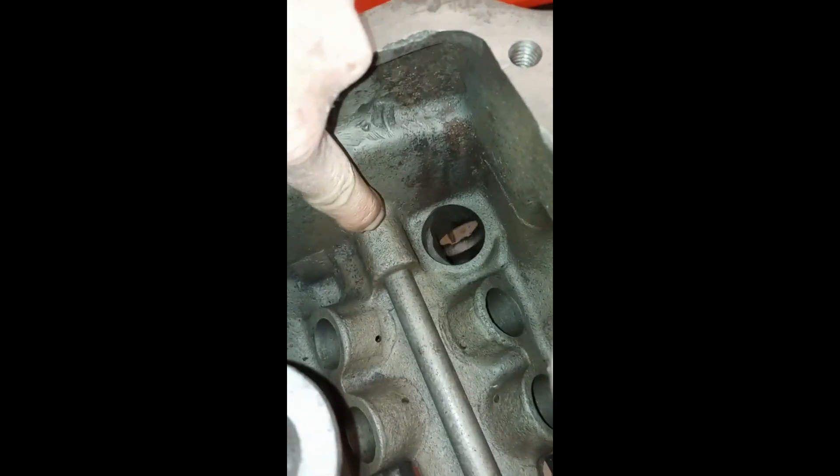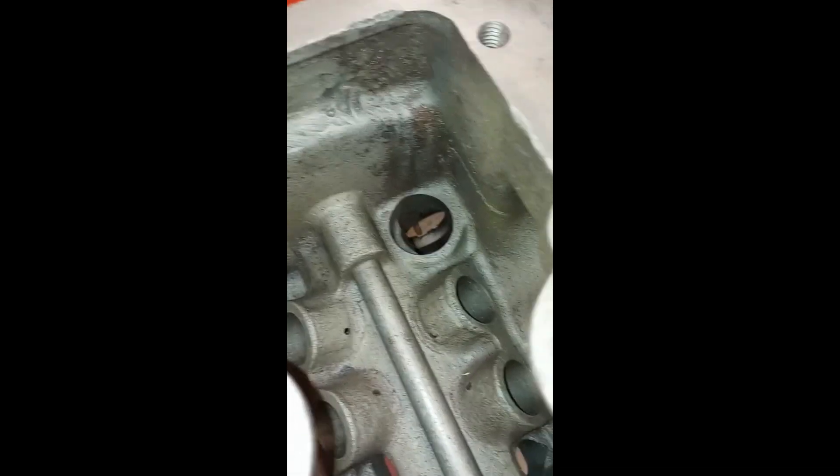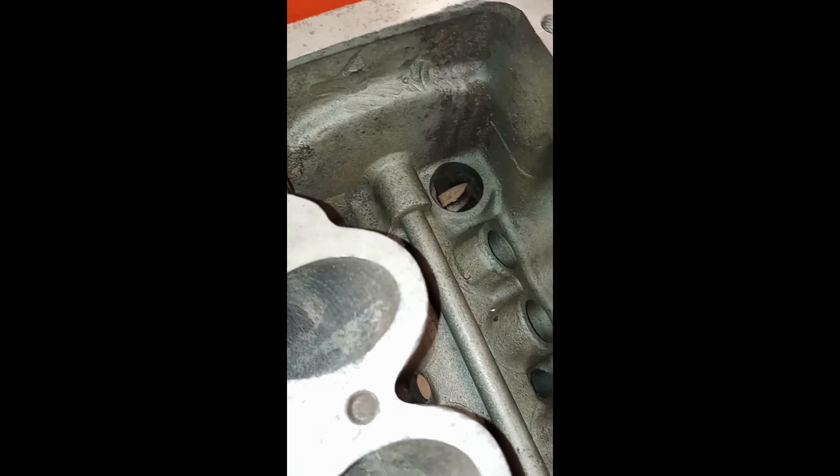The oil will flow forward through the mains and through this little tube. I also drill from the bottom and tap a hole that comes out through the front of the block — that's where I check the oil pressure, and on the motor with the turbocharger, that's where I get the oil feed for the turbo.